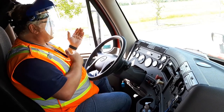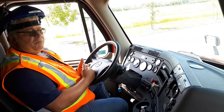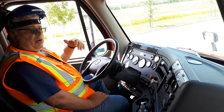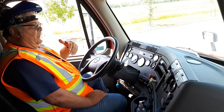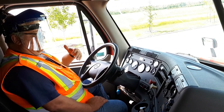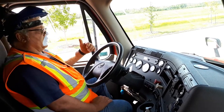My wheels are blocked. I have full air. Shut your truck off. Put the key back in the on position. Push in your yellow button. Start pumping your brakes down, explaining I'm waiting for my low air warning to come on at 60 PSI. Once that's on, I'm going to now explain that you're going to continue pumping until your button pops out between 20 and 45. The minute your button pops out, start your truck, bring your RPM to 1200.